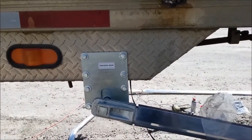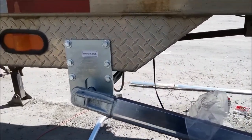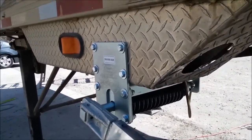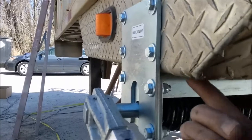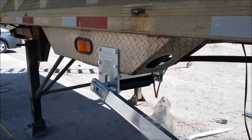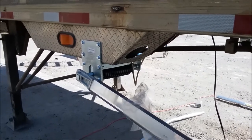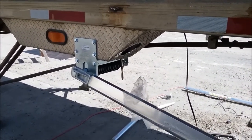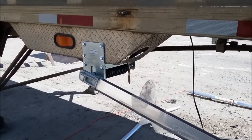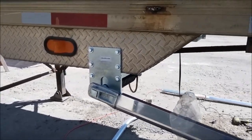That's the installation of an undermount spring assembly. Make sure you're nice and tight, square to the body, and pull it up tight against the bottom of the body or the bracket. Both sides are installed, so I can complete the installation of this system now. Thanks for watching, stay tuned — I'll give some contact information. Thanks, bye.